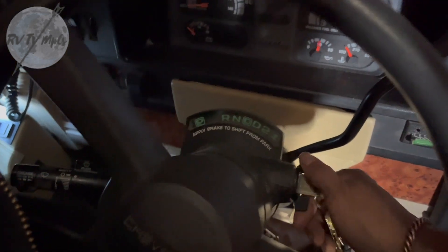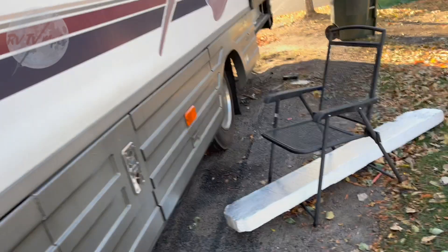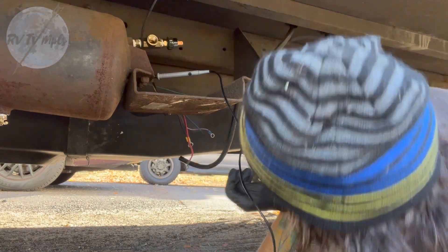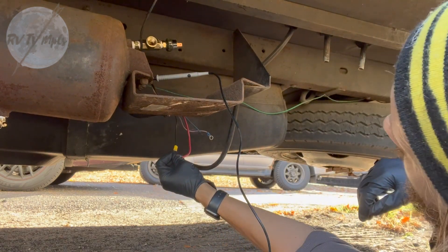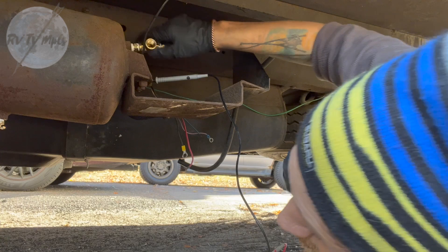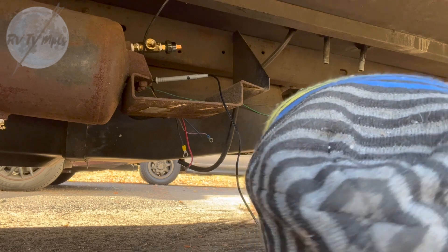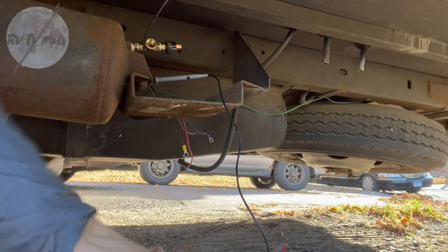I wanted to charge the battery for a few minutes — that should be enough. I gotta leave the key on and go out here and figure out how all that wiring works. I went ahead and clicked this from manual down to auto so I can see how this all works. I have 12 volts here on the gauge — I want to hear the solenoid for the air valves kick on. That clicks on the solenoids for the system because I can hear it letting out air. I don't want it to kick out all the air though, so let's be very careful — the last thing I want is to drop this down so low it's a pain to work on.